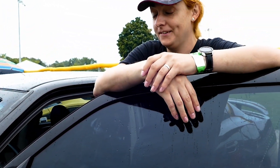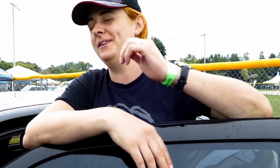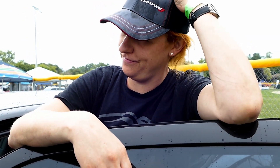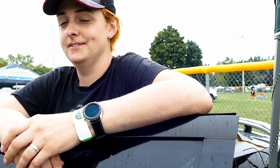How much horsepower are you pulling out of that 6.1 — well, you stroked it, right? I'm gonna say it's about 600. Phenomenal. Trap times in the quarter mile it's about 124-120. So that's about 500 to the wheels, which is about 600 at the crank. Is it a NAG1 tranny? I built that too. It's got nine clutches in K2 — originally came with five, now it's got nine. Modified piston.